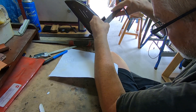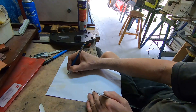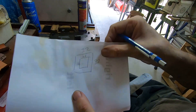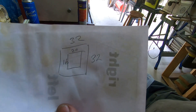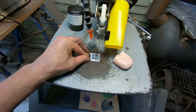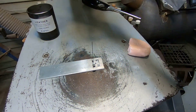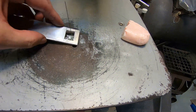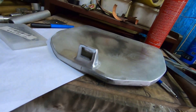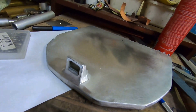Now for the technical bits — I've got to make that latch. So I measure the old one, write down all the measurements on a very complicated diagram, and I'm going to use aluminium to make this latch. I'm cutting out the square latch hole on the scroll saw. The scroll saw is really only for wood, but this does the job — at least it does a nice straight square, or rectangle anyway. Progressing along nicely, I've got the latch made and welded on. It looks something like the old one. Amazing.